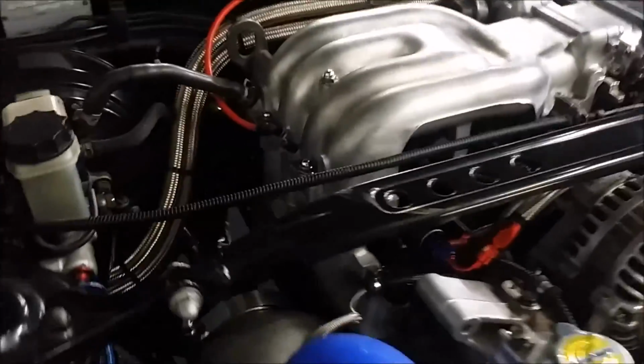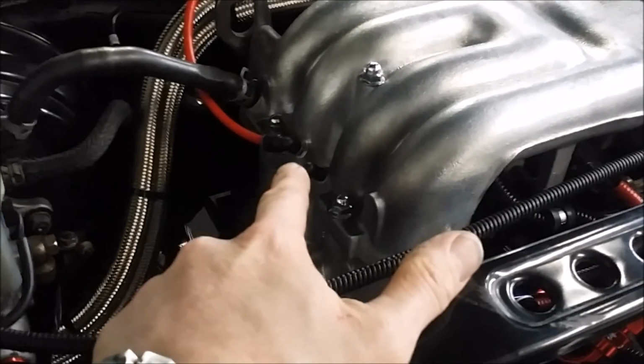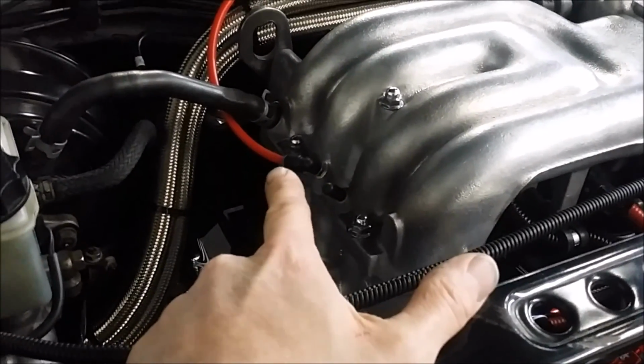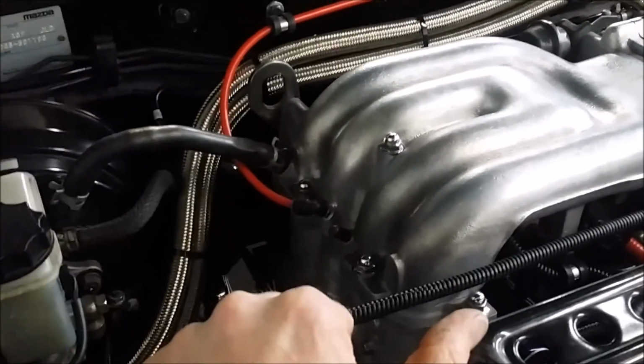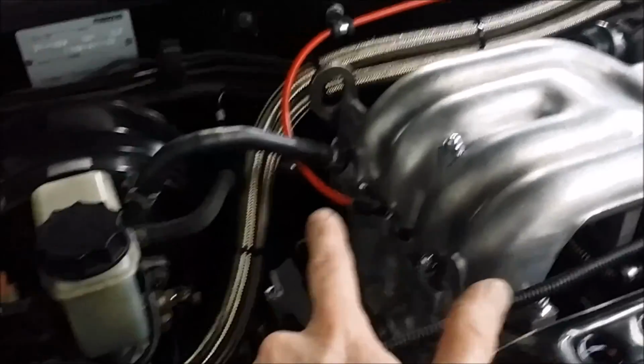So moving on, what I actually did with my UIM, I took the nipple off, I drilled it out, and I threaded it, and then put a 90-degree 1/4" push fit adapter onto there. Again, very easy to maintain, lots of blanks as well, of course, in this build.